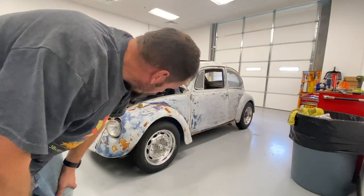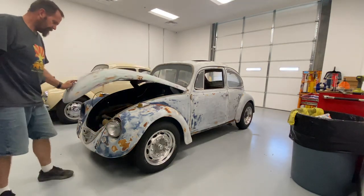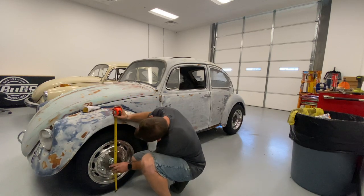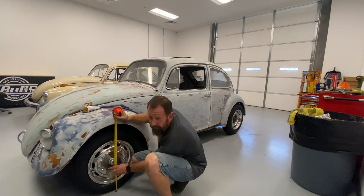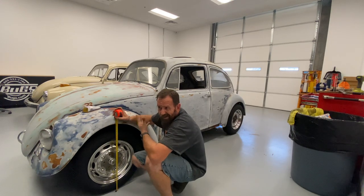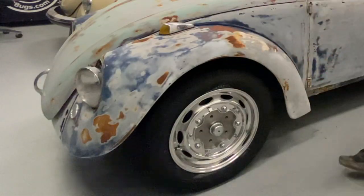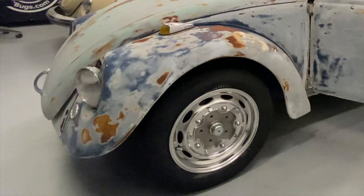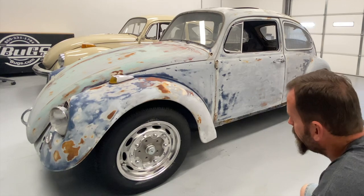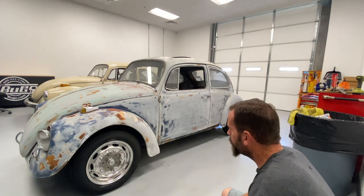It could be lower but it ain't. We were at 28 and a quarter before; now we're sitting at about 26 and 3 eighths. Keep in mind there's no fuel tank in the front anymore. Yesterday the car had a rear seat backrest, a driver's seat, and a whole bunch of dirt and debris inside. Today it doesn't. It should settle a little bit in time, and once we get a full interior and a gas tank full of fuel, I think it's going to work well.